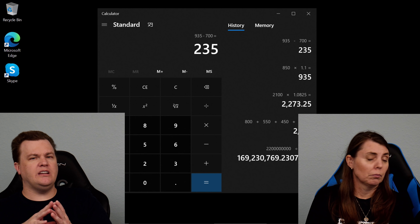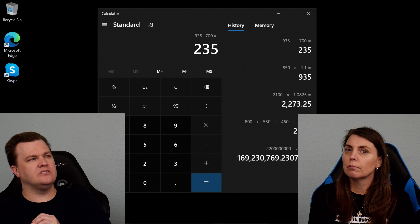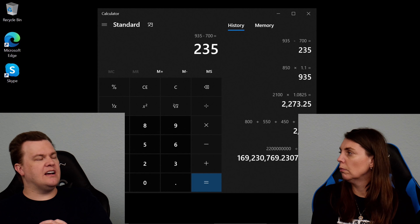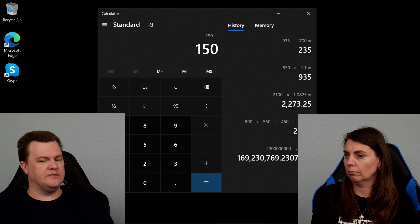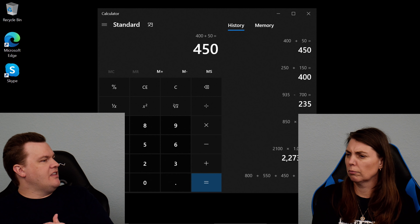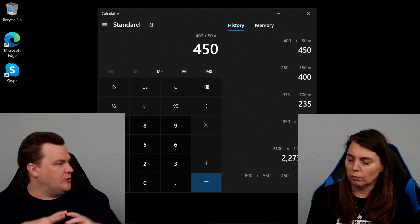If you're trying to figure out what you need, the wattage ratings are for your internal components. For example, an RTX 3080 needs 250 watts, and a Ryzen 9 3900X needs 150 watts at full bore — that's 400 watts. Add in SSD, motherboard, RGB lights, and a few other items. The video card might actually pull more than 250, but your CPU is likely not pulling 150 at the same time. You're either doing CPU-intensive or GPU-intensive loads, but rarely are they both at full load.